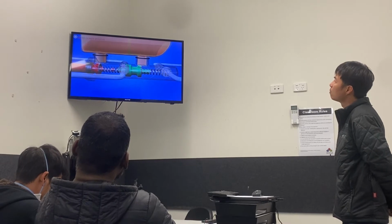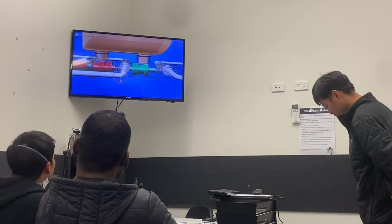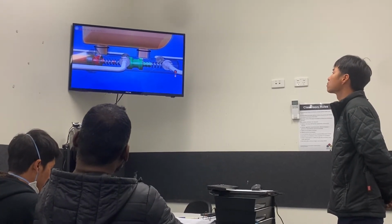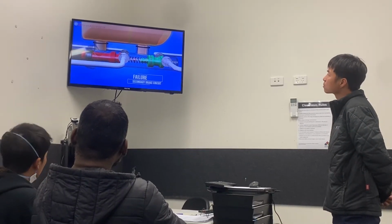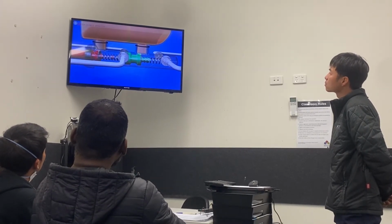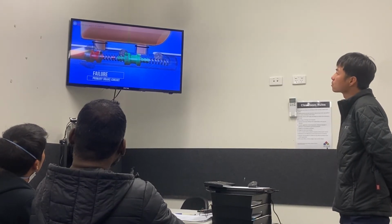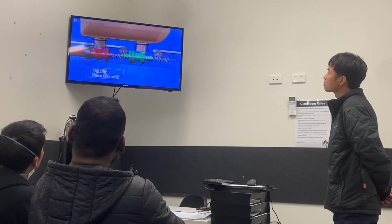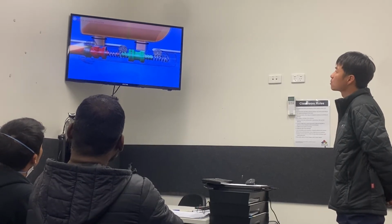The tandem master cylinder is designed to always provide brake pressure in at least one circuit for emergency stopping, if there is ever a failure in the other. If there is a failure in the secondary brake circuit, its piston will bottom. The primary piston will travel further down the bore and provide braking pressure to its circuit. If the primary circuit fails, its piston will move until the piston rod contacts the secondary piston. The secondary piston will now be operated mechanically to provide braking pressure to its particular circuit.